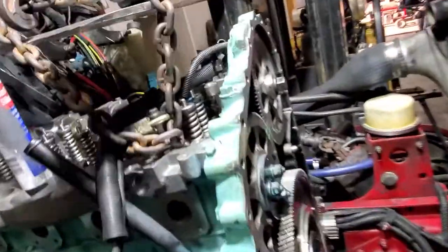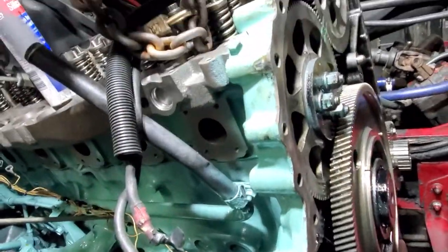When I went to go put it on, I'm like, holy shit, I didn't even clean this. Shame on me. I'm just warning you guys — I almost forgot to clean this up and put the RTV silicone on it. They don't make a gasket for it — obviously it would be too big. You're going to want to clean up everything really nice all the way around.